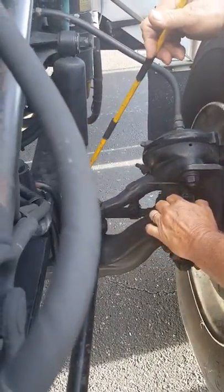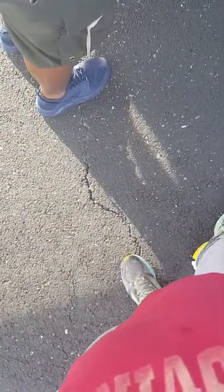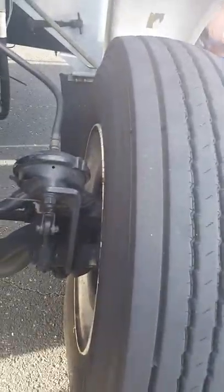When pulled by hand, my push rod and slack adjuster do not move more than one inch. There are some discrepancies about which one needs to be talking about moving one inch — the push rod or the slack adjuster — so if you say the push rod and the slack adjuster do not move more than one inch, you've got both of them covered. Two birds, one stone.